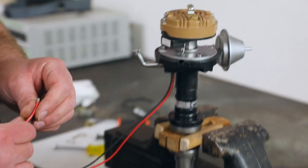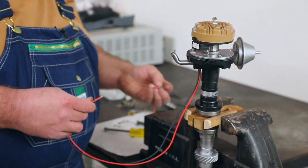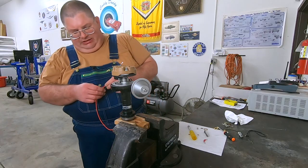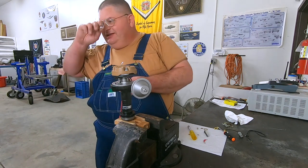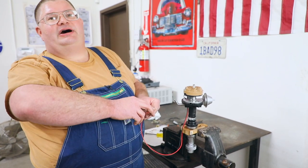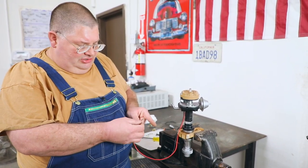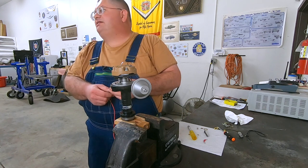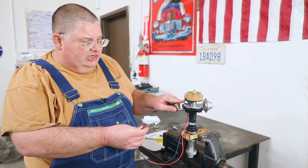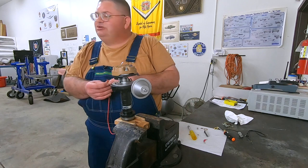The way this is wired up, instead of one wire you have two. It comes with a couple of lugs to crimp onto the end. At the coil, you have the positive and negative side. The red wire will go to the positive side going to your ignition switch. The black wire goes to the negative side of the coil where the points used to connect, because the module needs twelve volts to operate and also provides the signal to the coil. So it takes two wires.